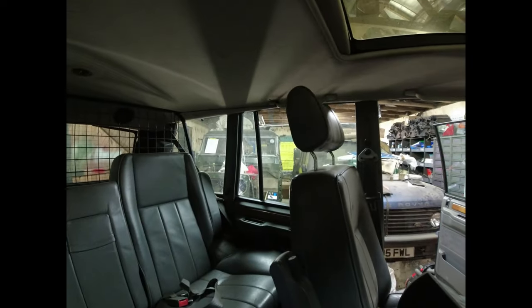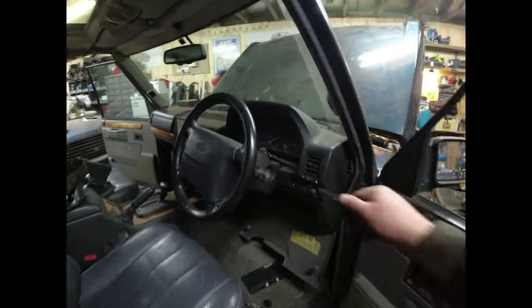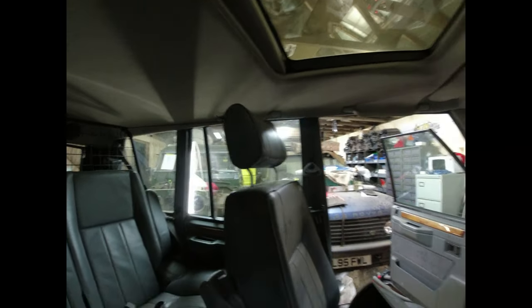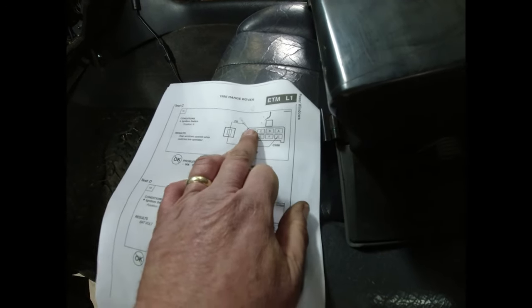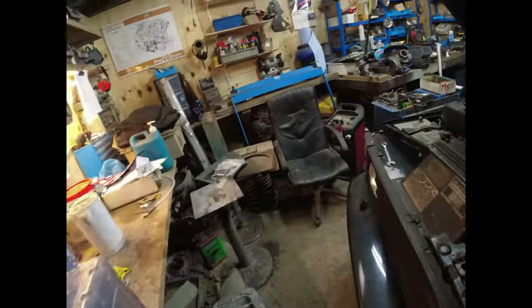It's annoying purely because the problem is actually within the ECU — I'm fairly confident of that now. Rob shows you that by bridging: take the eight-terminal connector off and bridge the purple-slate wire with the white-and-pink wire — that's D to E — using a little jumper. Then if the switches work, it's going to be the ECU. But as you've seen, I've got such an intermittent fault that I couldn't tell you whether it is or isn't. So there's obviously a dry joint inside the ECU. I'll talk to the customer about whether he wants me to fix it. The problem is that the windows can actually get stuck in the down position if you're not careful.